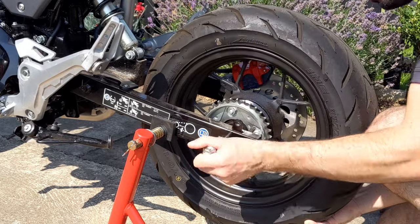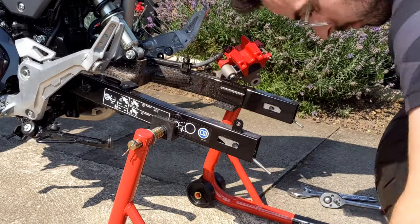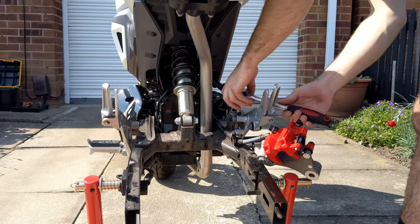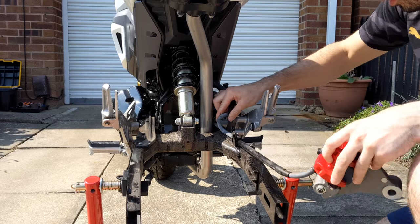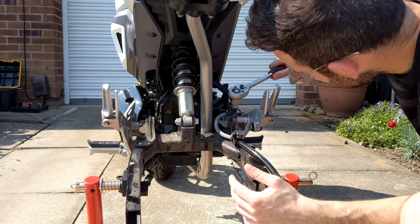I thought this part of the build was going to be quite tricky, which might be why I'd put it off for a few weeks, but it was super easy if you're thinking about doing it yourself. Once the axle is out and you've popped the wheel and little bobbin spacer to one side, you've got to rotate the banjo fitting on the brake line 180 degrees. This gives you an extra couple of inches of play that you'll need to reattach the caliper after you've got the stretched section in place. If you back the bolt off ever so slightly you can get the play needed to do this without having to go through the hassle of bleeding your brakes later on.